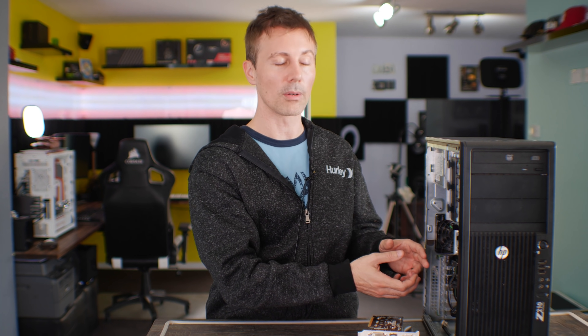I hope you enjoyed today's video on how to fix a PC that won't boot or just gets a black screen. Another thing you can try — if your PC has a speaker on it, you can listen to the PC. If it's booting to Windows but still giving you a black screen, it can mean the PC is working normally but it's just the graphics card, HDMI cable, or something like that not working properly. Even without a speaker, an easy way to test if the computer is working fine is to turn it on, leave it for about 30 seconds or a minute, then press the power button again and see if it cycles down normally. In Windows 10 it'll automatically start turning the computer off, with a few seconds delay — that can indicate whether the computer is generally working fine versus something wrong from the get-go with the motherboard, RAM, or CPU.